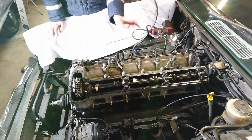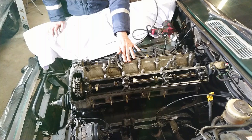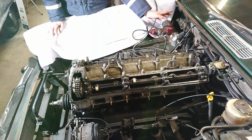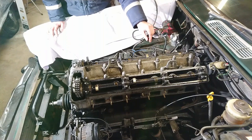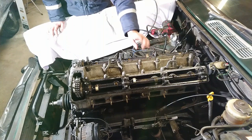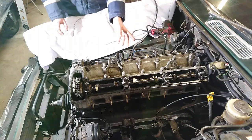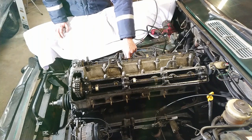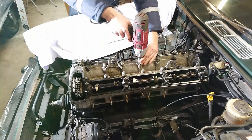I've talked to a couple experts who restore these engines on a daily basis, and they've all told me that they think I should use an electric sort of air hammer to remove these. I'm usually not a fan of electric tools, but with the knocking effect of this one set on really low, I have a bigger chance of getting the dome nuts off without getting the studs off down there. Because they say if I put a big breaker bar on here, firstly, I might break the studs, and secondly, I might unwind them down there, which I don't want to happen. So, wish me luck. Let's see if we can get these off.